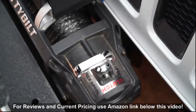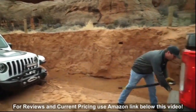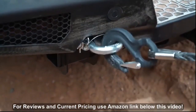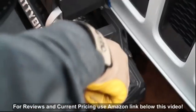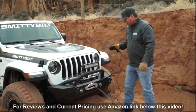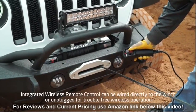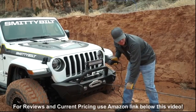The first thing we're going to do is put this winch in free spool. We're going to free spool out and hook up to something that's got more capacity than the winch itself. We've hooked onto this Smittybilt D-ring. We're going to come back over here and lock up this cable so all the pulling power is on the drum. Using gloves, we're going to feed this cable back onto the drum and now you can hear the tension of the vehicle.